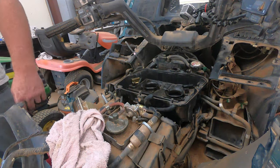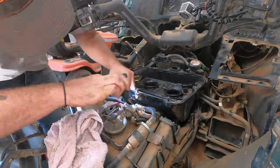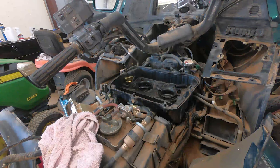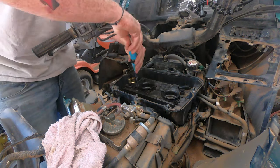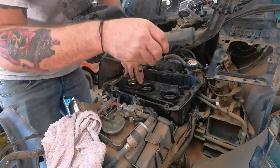The circle one I found was the best to put in that hose to the front-most of the motorcycle. The order was: install the front hose, and then the back two after that. There is a hose clamp on there — if you can get the hose and the hose clamp on at the same time, it'll make your life way easier.